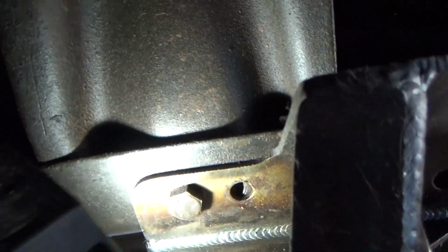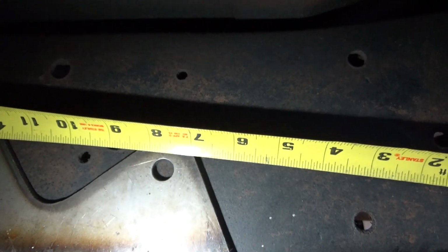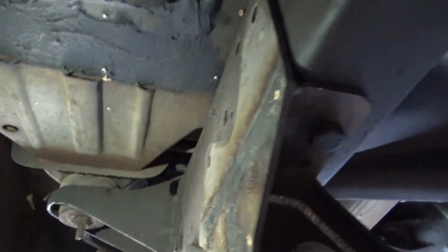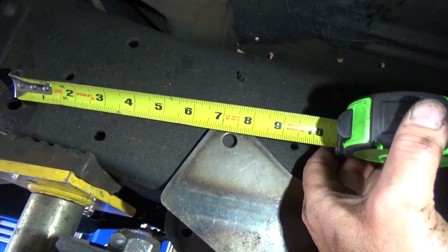Well, that's an odd little problem to have. So this one's bolted in the rear hole, and this one's bolted into the front hole. Well, that creates a problem. Weird. Seven 5/8 on center. That looks correct. That is the forward hole and the forward hole. The rearward hole and the rearward hole puts us at just under 7 inches. Sorry, at 7 1/4 inches on center.